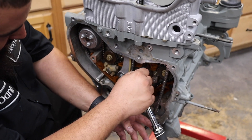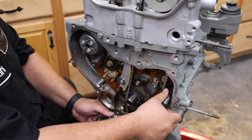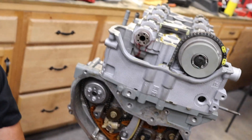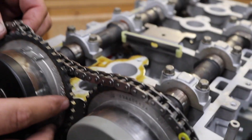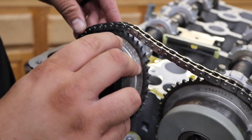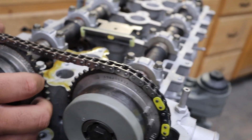Since it's all the same torque spec, we just waited until now when it was actually important to go ahead and torque it over. We're going to go ahead and grab this guide right here - you do have to kind of slink it around the camshaft. I'm going to go ahead and align that diamond mark with the timing mark on the chain itself. There she goes and we need to work this cam.